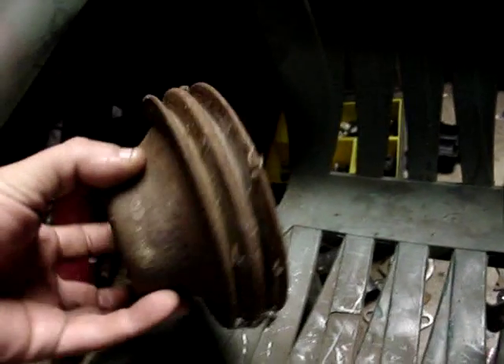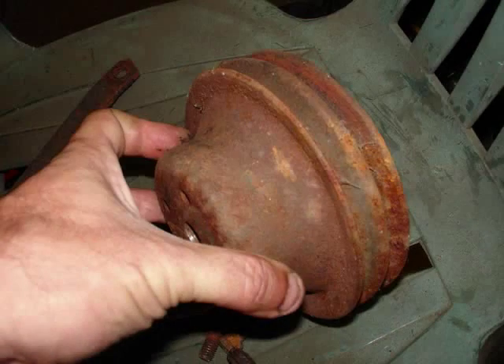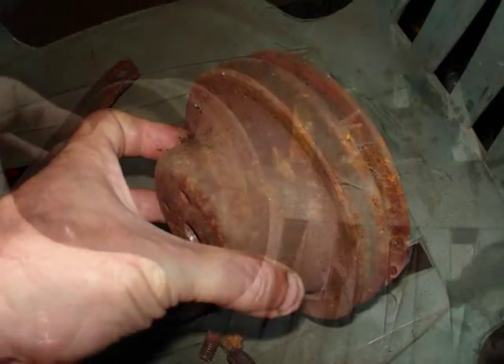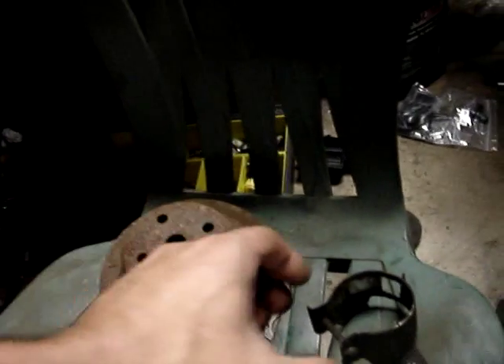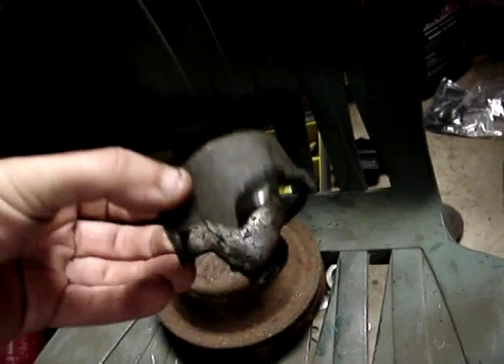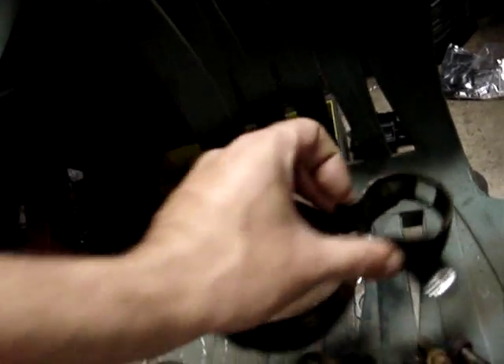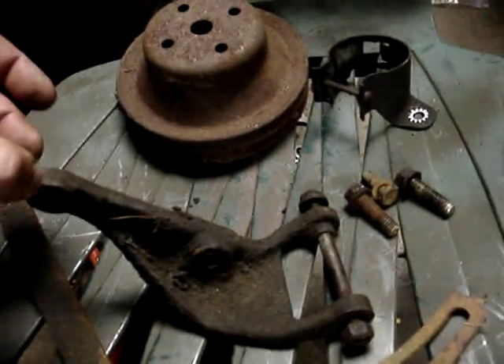He says, this is a 72 GMC motor out back, and wouldn't you know it, here's the rare dual pulley — 72 GMC truck dual pulley for a short water pump. And on the same engine was the intake mounted coil bracket, both tabs, not one like the Willys tab. And I'm looking at it going, that's a freaking cool alternator bracket.